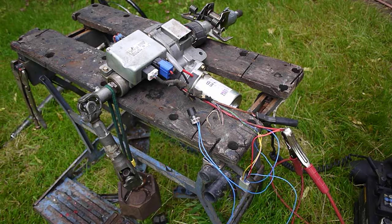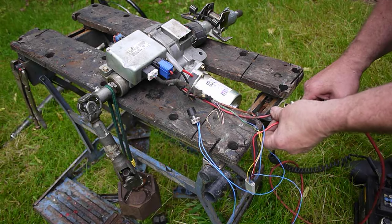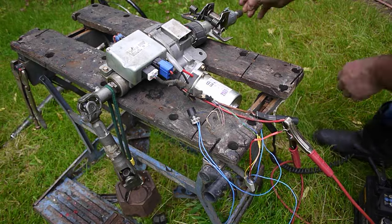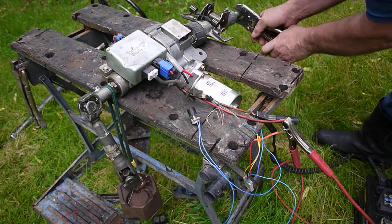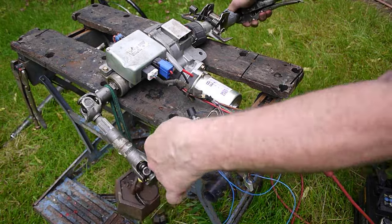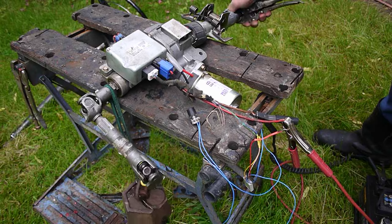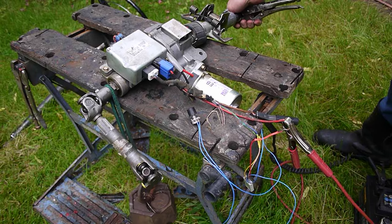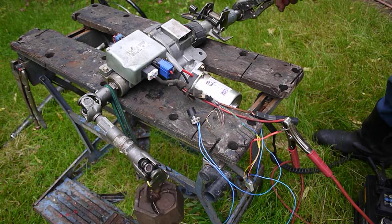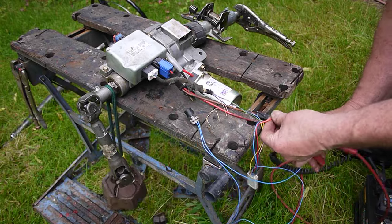You can manually adjust the feel. With the ignition off, if I try turning this shaft it's very difficult. I've put mole grips on — I can turn it reasonably easily. I've got a five kilogram mass attached to the end, so I can't lift it all the way up in the center when holding the end of the mole grip — just about able to lift that mass. Now turning the electric power steering on...